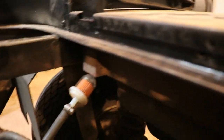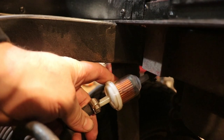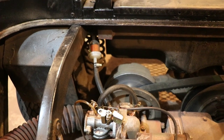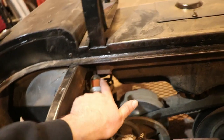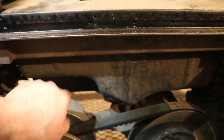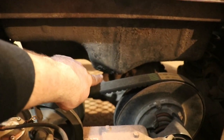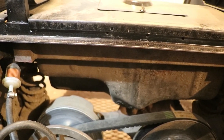After changing this fuel line around yesterday, kind of see the fuel level in there. And I was noticing that if you went over a bunch of bumps or kind of turned a tight radius quickly, it would sputter and die and there'd be almost no fuel in there. So I'm wondering if I have a pickup issue going on where, well, based on this interestingly shaped gas tank there, I'm wondering if the pickup line doesn't actually get all the way down to the sump. And if we're turning one way or the other, it's starting to suck a little bit of air.